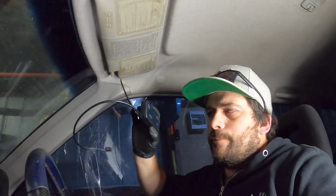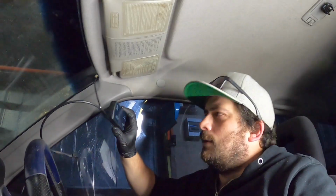Alright guys, I was just thinking then, this is to control the GT35. I was just reading the instruction and then it said to put it to intake manifold, which would actually end up not controlling it properly. So what I need to do is actually put this vacuum into the GT35.